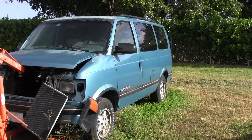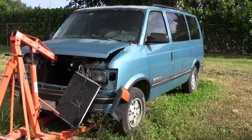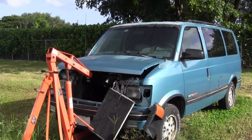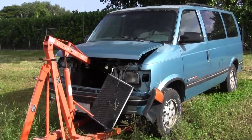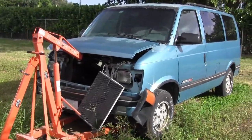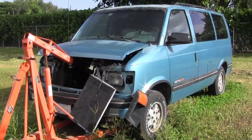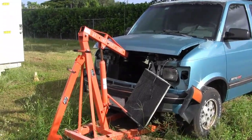After 1995 they went to sequential fuel injection, CSFI, and after that around 2002 I'm not sure what they did. The fuel injection module is hard to get, but I found one refurbished through GB Remanufacturing by contacting Rock Auto. I've now got one good one and two spares, all three through GB Remanufacturing. To convert this to something like a Holley Sniper 2, you'd need the manifold, fuel injection, probably a new tank pump, and an adapter for the computer to make the Sniper work with the 4L60E transmission.